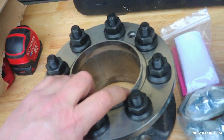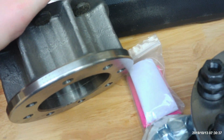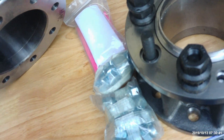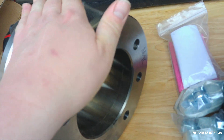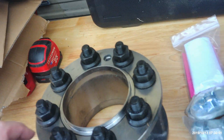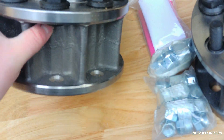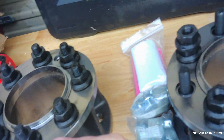Okay, here we are. These are, like I said, steel adapters. These are for the fronts. The rears look different — the rears are a three-inch spacer and this is all filled in on the rear adapters. So when you go to Southwest Wheel to order these, you need to look very carefully because you need front ones and back ones, and you've got to make sure you get the right ones.